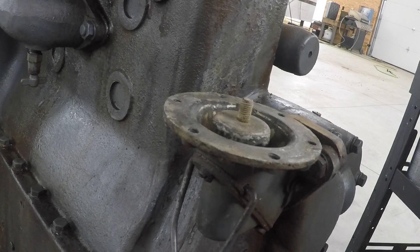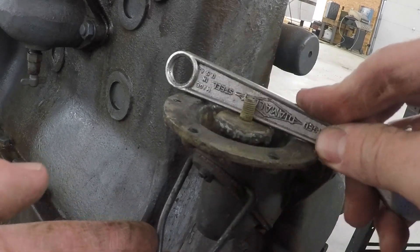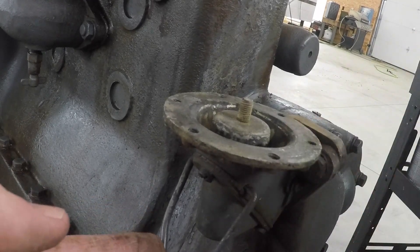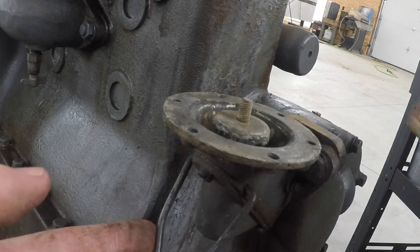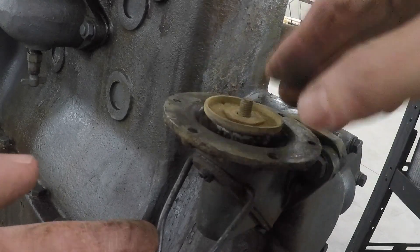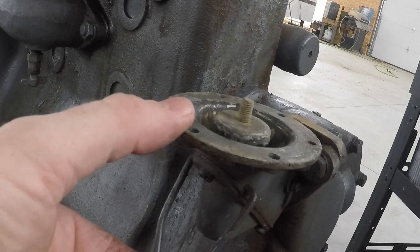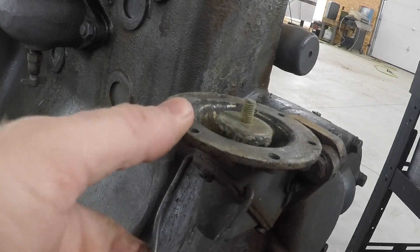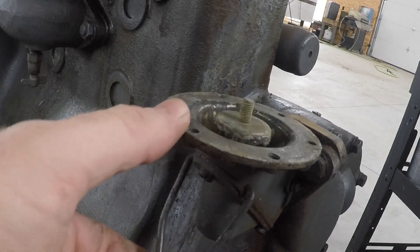So what I'm going to do after I make my piece of rubber and fit it in here, I'm going to set this right about level so there's no slack in the new diaphragm. Set that in there, and there's just this little plate that goes on here to clamp it. You bolt it down and then you put the top back on. Also, it's got this hand pump here, so before it's running, you can basically prime the system and get fuel.